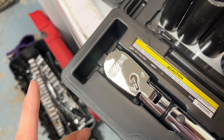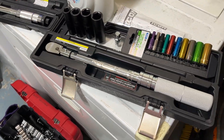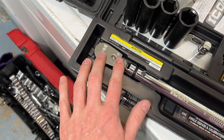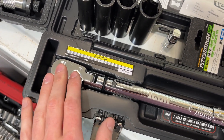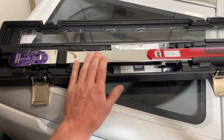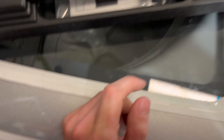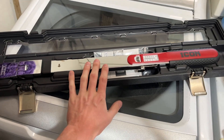I recommend doing this once a year. It's not hard — take the tire off, come under here with a torque wrench, torque it yourself. You don't have to pay Tesla; they're going to charge you an arm and a leg. If you have a Harbor Freight near you, they make pretty good torque wrenches by Icon, which is basically a Snap-on knockoff but with a lifetime warranty. Anything happens, bring the tool to Harbor Freight and they'll replace it for free. I used to work at Harbor Freight so I can tell you they do stand up to their warranty. For this job I'd get a half-inch torque wrench — a long one. You can use it on your wheel lugs, which I'd recommend torquing to about 130 foot-pounds.